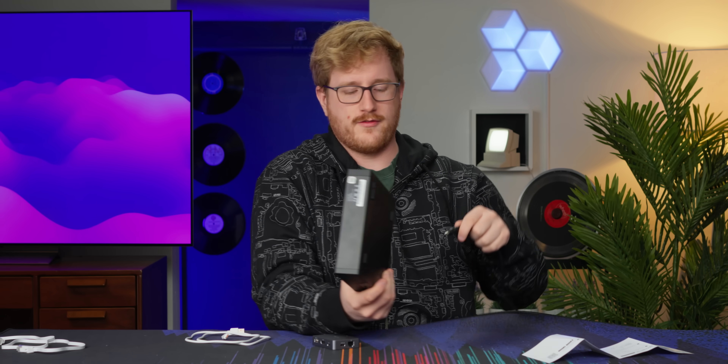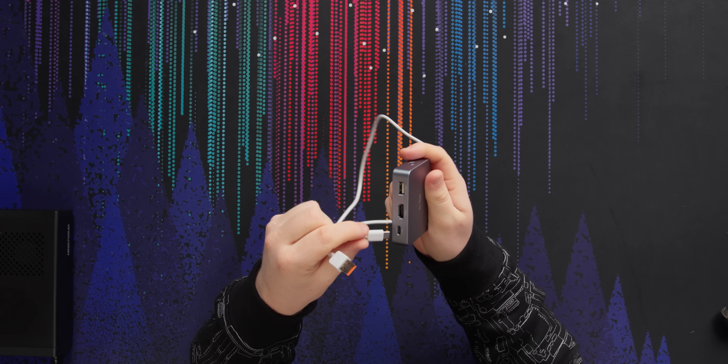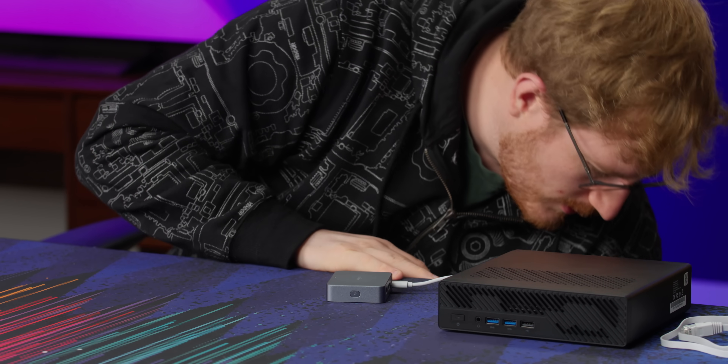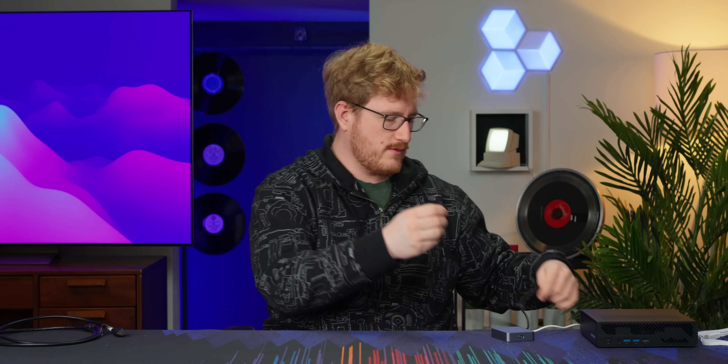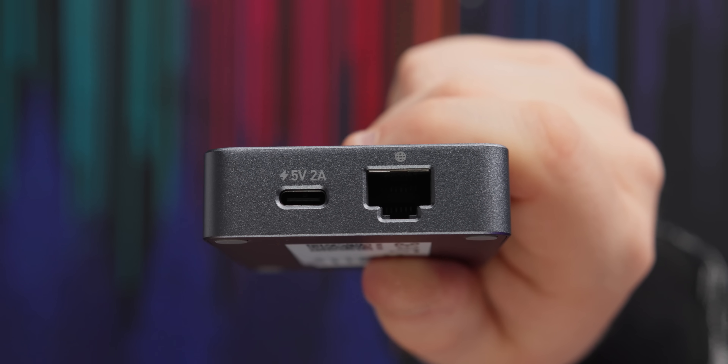Let's plug it in. Since it's so perfect for this, I'm quite literally just going to use this MinisForum as our remote computer. We've got our A-to-C cable for HID — the human interface device, otherwise known as keyboard and mouse — so we'll plug that into our MinisForum. Then we have a USB-C power cable, so there are two separate cables: 5 volt, 2 amp. It does come with the USB power cable; our unit is just a really early sample. If you buy one, it will come with both USB cables, an HDMI, and the Ethernet.